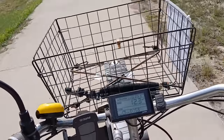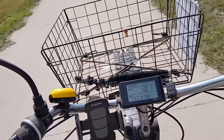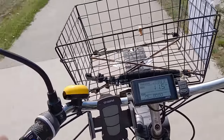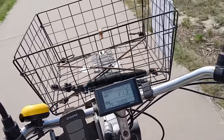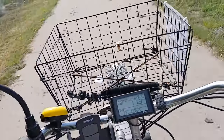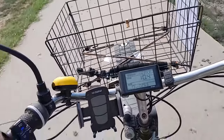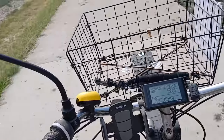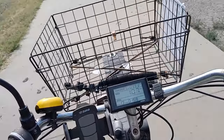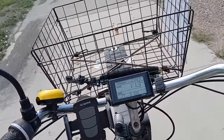This little design I've got here uses the Schwinn Meridian frame. It's one of the most highly rated tricycles, even though it has a kind of terrible rear axle, if you ask me. It doesn't have a differential, it's single speed, and it has these kind of crappy drum brakes. It's lacking on so many levels, and when your wheels start coming off like they did on me and you get big scars on your shoulder, then you start thinking about this stuff. You gotta have a differential. That's the deal. And you need good brakes. Have to have them.